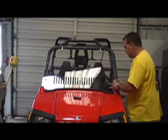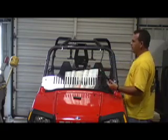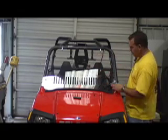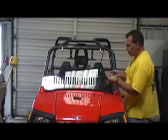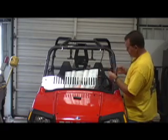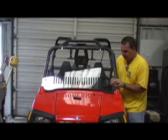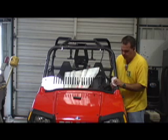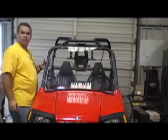One thing I need to tell you though is if you get to a point to where they all won't fit, don't put your vent on just yet, but flip the windshield over and it'll fit, okay? Now you want to take one of the enclosed screws and a washer. Alright, run it through rubber grommet into one side of the clamp and into the other side. Put the enclosed nut on the back. At this point, finger tight.